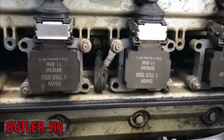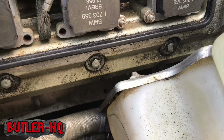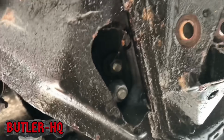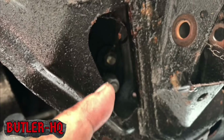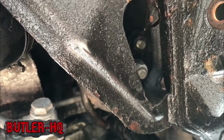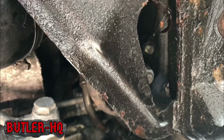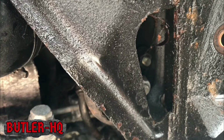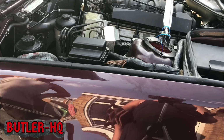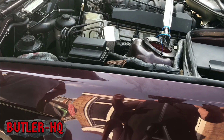And the other engine mount is literally just down there. The top ones are the hardest, the bottom ones are the easiest. So we need to remove two nuts on either side. And what we do is we just lift the engine up a bit to give us more angle at the top to get the extensions and wobbly bolts in. With the bottom mount undone, it's time to jack up the engine a little bit with some wood underneath so you get better clearance at the top.